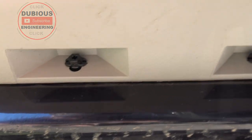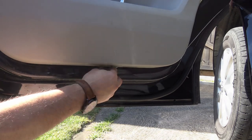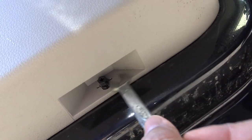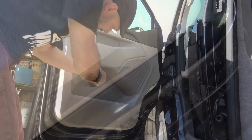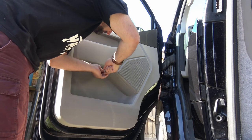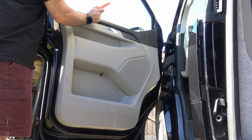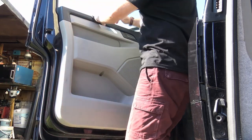These little bolts here, they're not actual bolts — they're just little tabs that you have to align. When they're aligned, that means the bottom of the door card can be pulled away from its location. So there's two of those to do. And then there's one little T25 Torx bolt in the middle. And then at the top, underneath the door handle — which you need to remove with the plastic trim tool — are two T30 screws. So you'll need to pop those bad boys out.